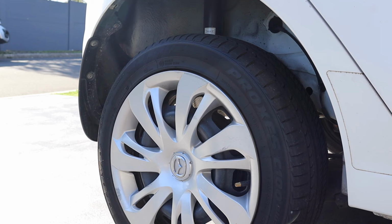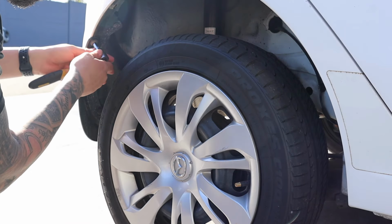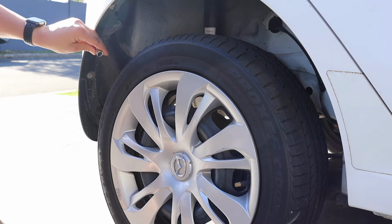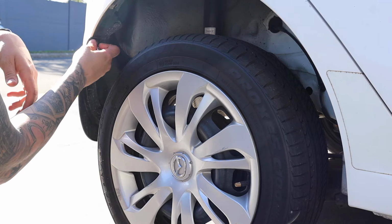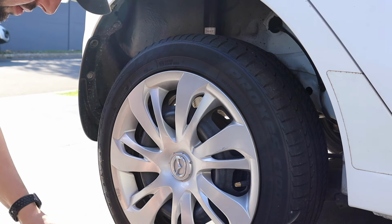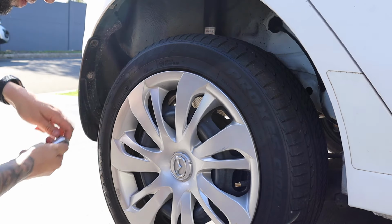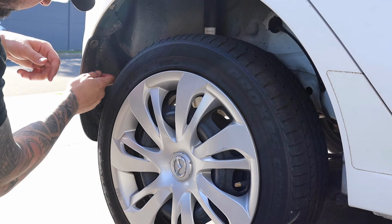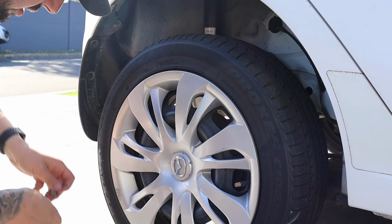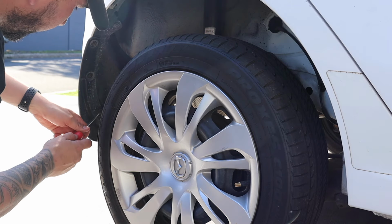Day 2. And what we're doing today is, I know you can't see me right now. First off, we're going to pull these mud flaps off. From there, we are going to attempt to remove the rear bumper bar. And from there, we're going to remove the rear crash bar. Now, we wouldn't do this if it was a road car because it protects the chassis and the boot floor and all that stuff. But because it's a race car, we want it light as possible. It'll still be safe, but if someone smashes into us, it probably won't look too good after that.